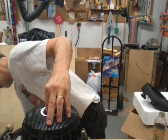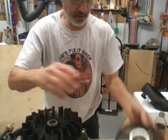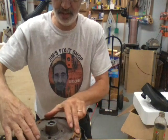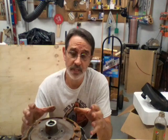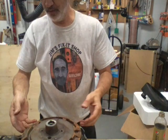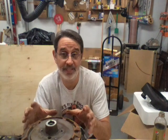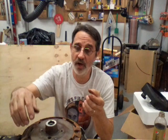Well, that wasn't as bad as I thought it was going to be. It did have Loctite on it, it looks like. So you take all this stuff off, take this fancy little cover off, and there are two threaded holes. Now if it's a pretty rigid-looking flywheel, in the past I've used a big wheel puller if you can get it on here, but this is enclosed so much that I don't think I can get a wheel puller on here. You do stand the risk of breaking the flywheel by using just a standard three-fingered or two-fingered wheel puller. These two holes drilled and tapped right here — that is what they're meant for, to pull this flywheel off.